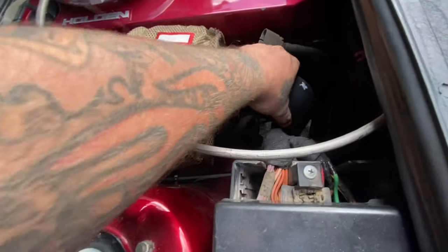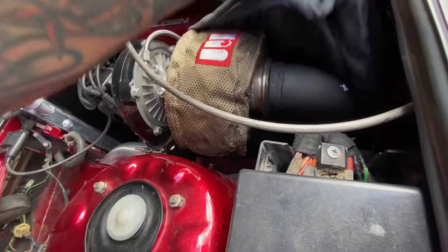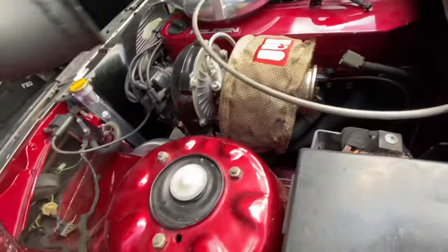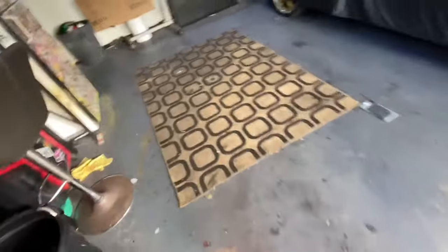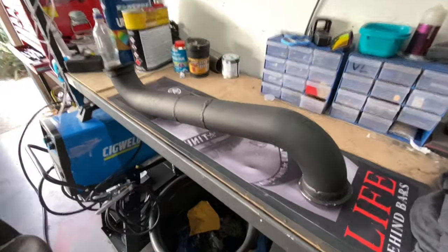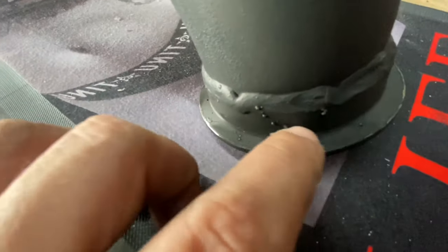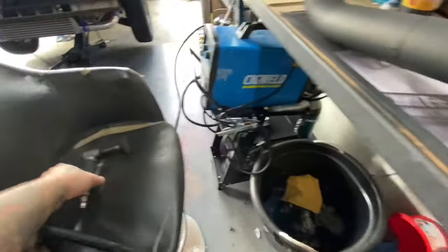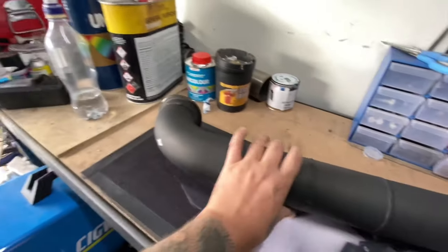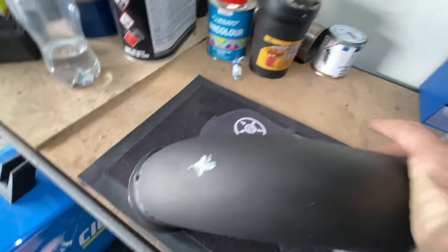So we're just going to pull this dump pipe out. She's a bit warm. Might whack that on there and get her out. And I'll tidy up this bench, we'll sit it up on that. The exhaust leak, I reckon, was coming from this welding splatter. So I've just got the whizzer here, it's going to whiz that off and make that all nice and smooth. And then, on the top of the dump, right there, we're going to add our O2 sensor.